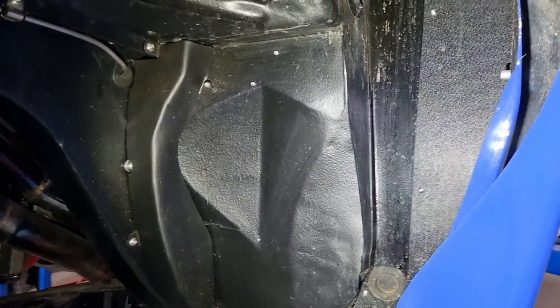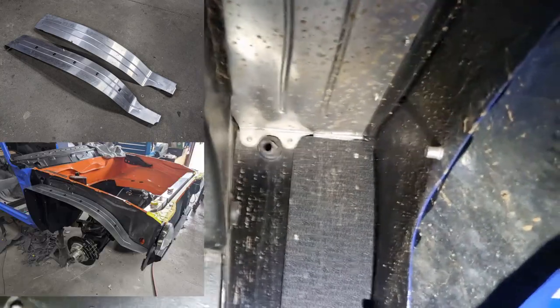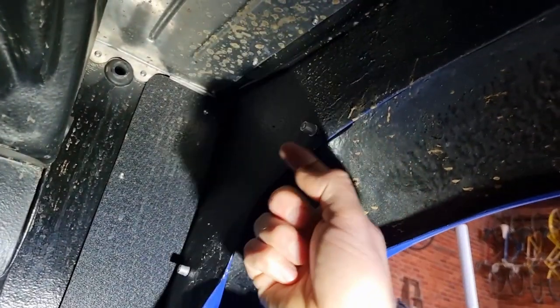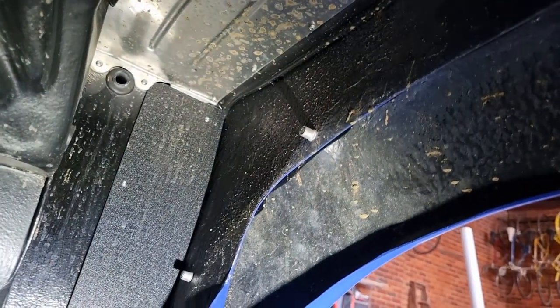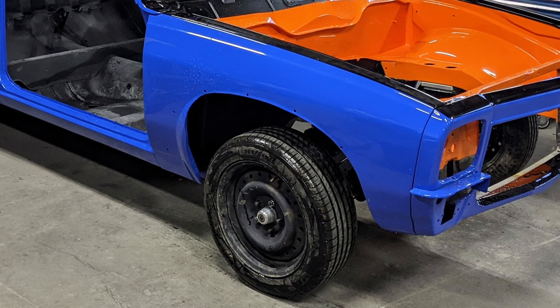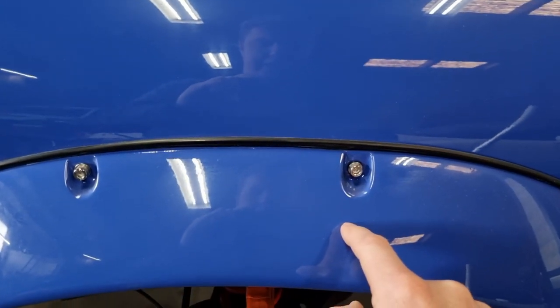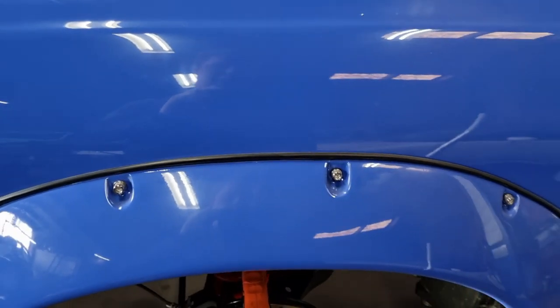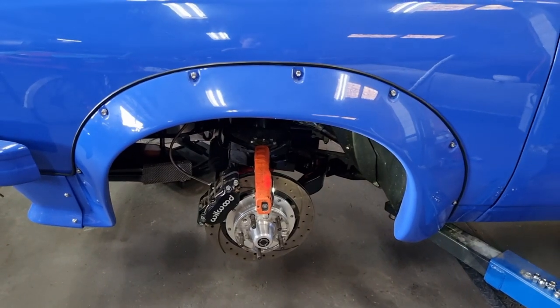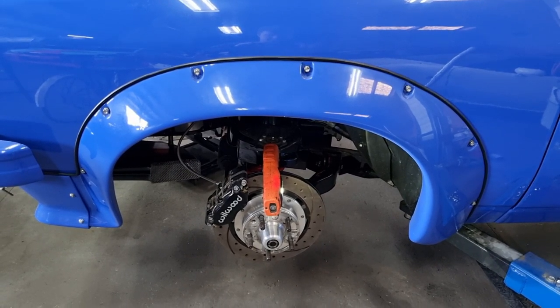This here you can ignore — that's just a shield, a stone shield for some fuel plumbing. I've got inner guards on this car that I made — they're ABS plastic at the back going to sheet metal aluminium along the top. That's just my own thing; you don't need that on yours. The guard cut is pretty intuitive — basically you just look anywhere the wheel might get close and cut the guard up right near where the flare bolts are. There is absolutely no reason to leave the guard hanging down low. Cut it the whole way up — it doesn't do anything advantageous leaving it there. Cut it off, get as much real estate as you can so you can have the car low with loads of tyre and negative offset. Enjoy, good luck with it.